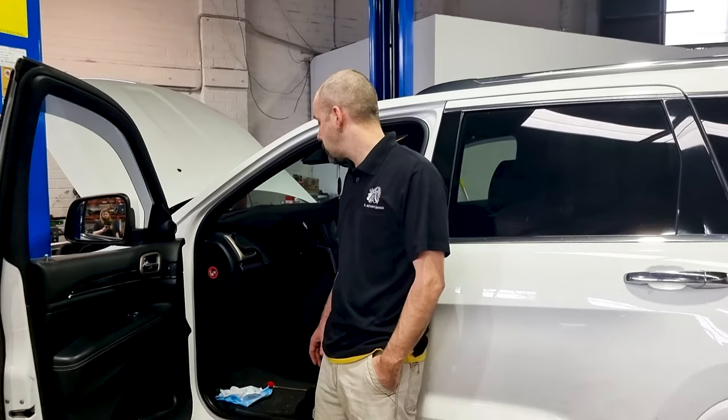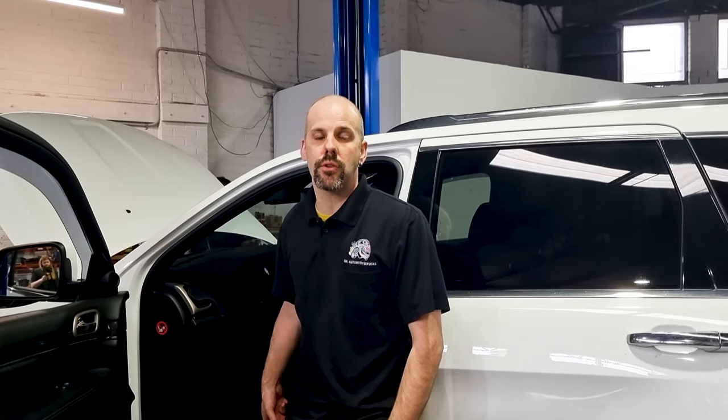If you're having trouble with water getting in the car, check your sunroof drain tubes. Or if you're getting fault codes for the transfer case module, a four-wheel drive warning light on the dash, or anything related to body control module issues, check that you haven't already got water in there — it may be too late. Water and electrical things do not mix.